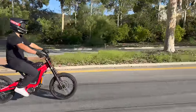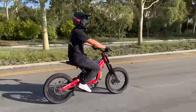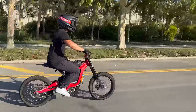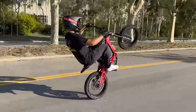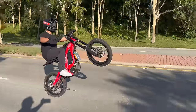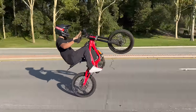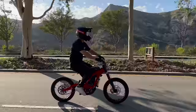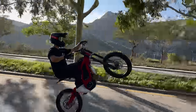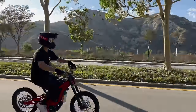With an upgraded controller like this one, you can tune your regen levels. Regen is how much the engine brakes automatically when you let off the throttle — that braking energy regenerates back into the battery. I think it's safest to wheelie with a high regen level. The rear brake on these bikes does overheat and fade over the course of your ride, and with a high regen level, you hardly need to use your brake during the wheelie, decreasing the odds of it overheating.